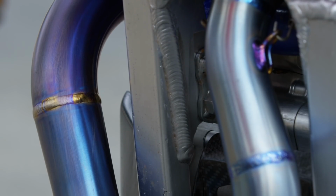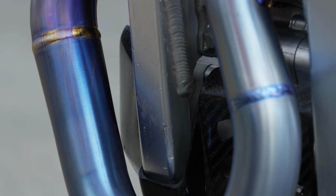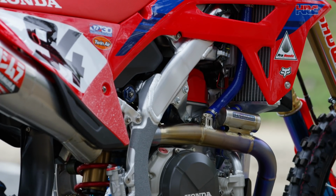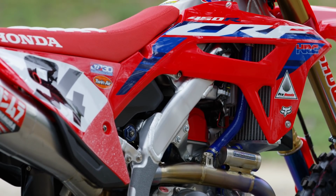The frame and swing arm on this bike appear to be stock, but as we know with AMA rules, it is legal to gusset certain areas of this frame. We cannot remove material from the frames and be legal, but these teams can go in and add little corner welds and add material in certain places as they need be. This is something the team has been playing with a lot on this generation bike we've heard. We don't know where exactly they've ended up. Once again, between Supercross and outdoors, there's different feelings these guys could be looking for. This thing could be as stock as your or my bike, or it may have some small modifications that we are unable to see, but are still completely legal by today's rule book.